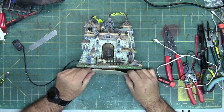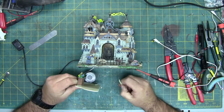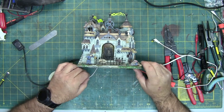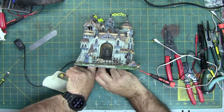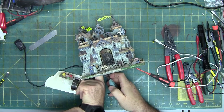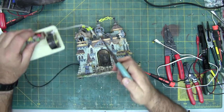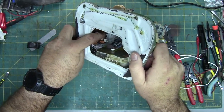Now I'm just going to pry out some of this glue so we can get this bottom out. There we go. So now we have the base out. Attached to the base, besides the glue, is the speaker and what almost looks like a fireplace — but it's not, it's a little shelf counter thing. I'm going to unplug the speaker and move this base out of the way. The speaker physically plugs in — it's got a little Molex plug.